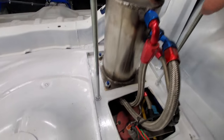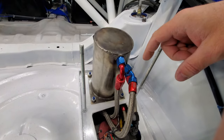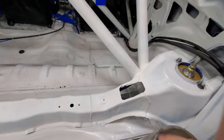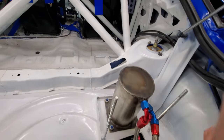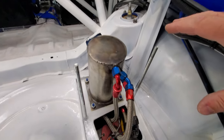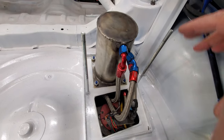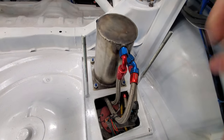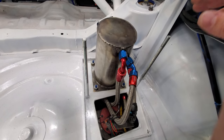On the bottom of this tank — you actually can't see it, it's really hard — it's directly underneath here. Coming out of the bottom of it is a Weldon Dash 10 fitting. That Weldon Dash 10 fitting comes directly out of the tank, goes straight, and that other access panel right there is actually where the A1000 Pro and the fuel filter sits. Both of these systems — the way that we designed this — is to keep it outside of the cockpit. You may have seen that box at the beginning of the video. That's an aluminum box that's ticked up to where we close this guy down, button it up real tight, and we even take some high temp tape and go around the bottom of it just to make sure that no fumes or anything else could potentially escape.